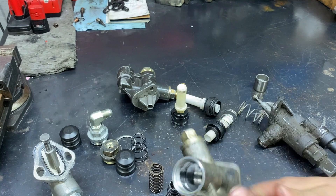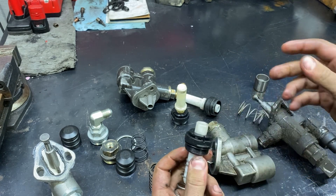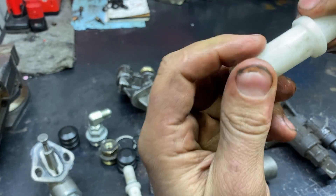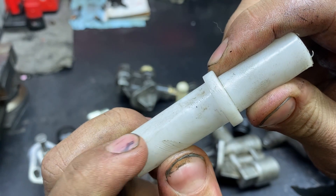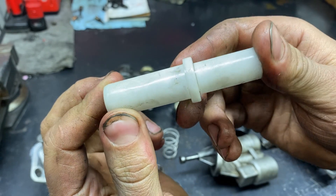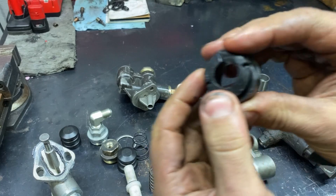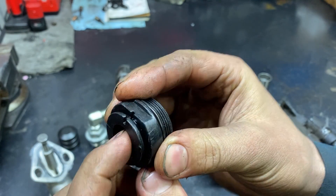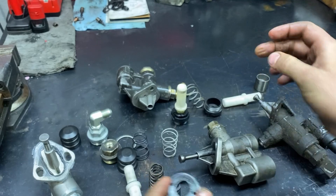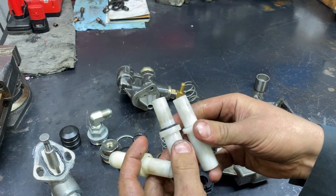This other pump worked fine and had a good plunger in it, but the priming plunger was losing prime and getting fuel pressure past it. When I pulled it apart, there's a groove worn right there. Either through losing fuel pressure it wore it down, or through me pushing it to prime it too many times. This might just be inferior plastic. I also noticed grooves worn on either side — the other pumps don't have that groove, and they're fine.